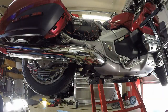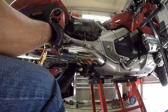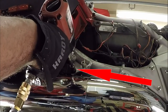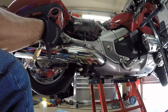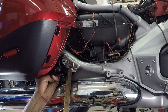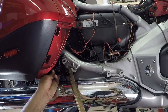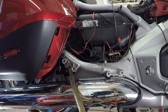After removing the rear crash bar, remove the lower subframe mounting bolt. Once you remove the subframe mounting bolt, you have to drill out the threads with a 5/16th drill bit. I used a wooden stick to take pressure off of the lower subframe.